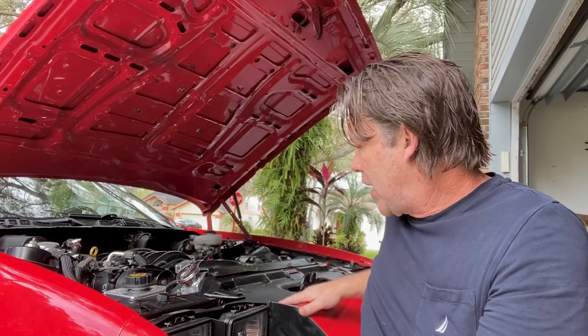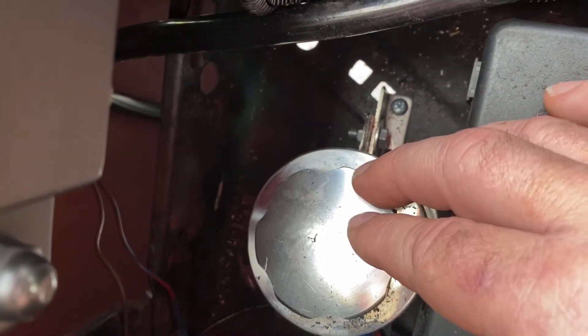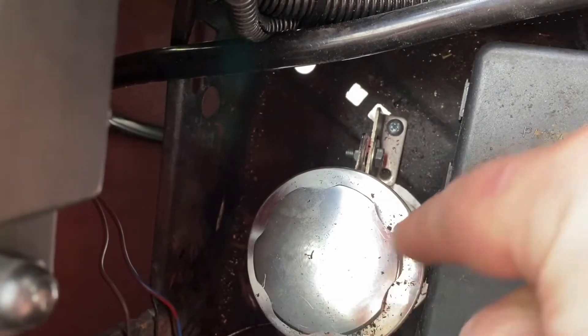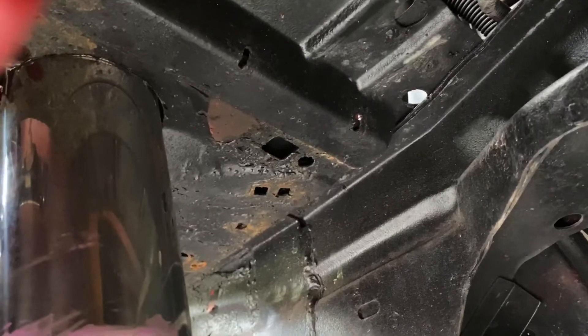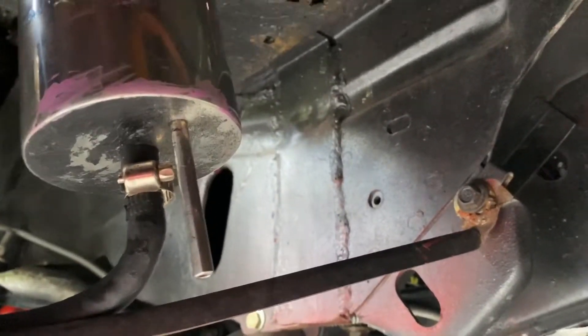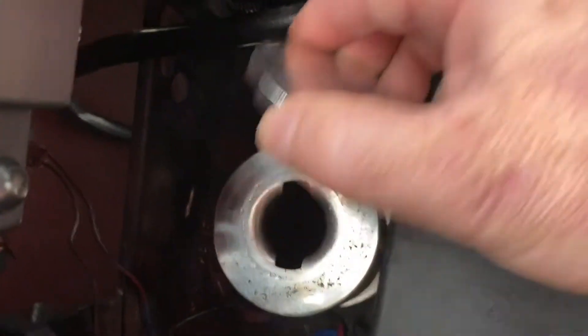I took a little over a three-inch hole saw and basically put a hole in the battery tray. I fed up the coolant reservoir that used to be right here, but since I mounted the heat exchanger I'm no longer able to run it up there — it just won't fit. So now I've got a hole in the cover and I'll need to get another cover. I mounted the reservoir through the original battery tray, and if you look under the car, most of it is under the battery tray. Only about three or four inches sticks up through, so I can check my fluid easily.